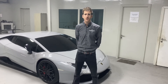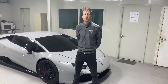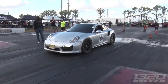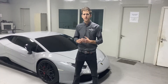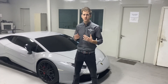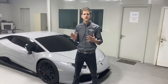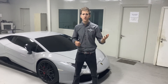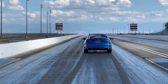We also do a kit for the 911. AIM have been really helpful and Emory at ES Motor have been part of the beta program, and we've been testing it for a long time. Some people may have seen the car doing burnouts at the GTR World Cup and how well that was working. That car has a really big tyre on the rear and really small tyres on the front. With a factory all-wheel drive control unit looking at slip between the front and rear axle, a massive difference in tyre diameter means the unit won't work as efficiently. So we've added the ability to use tyre scalers to ensure centre slip is always calculated correctly. The unit has been tested by the guys at IROS on the RS3 for well over a year, and the results have been serious — it's transformed the car in terms of acceleration.